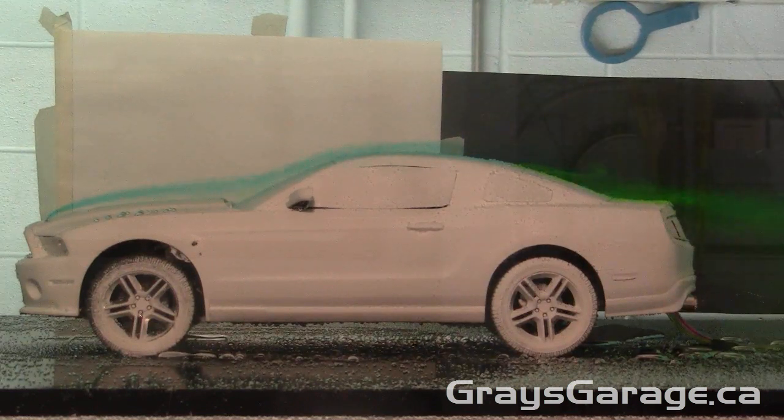This is a dye that fluoresces and glows under a UV light source. The green dye is showing the flow along the rear of the vehicle — it's a little bit slower moving and more turbulent — whereas the blue is showing the flow over the hood and upper roof, which is faster moving, being accelerated, and smoother.